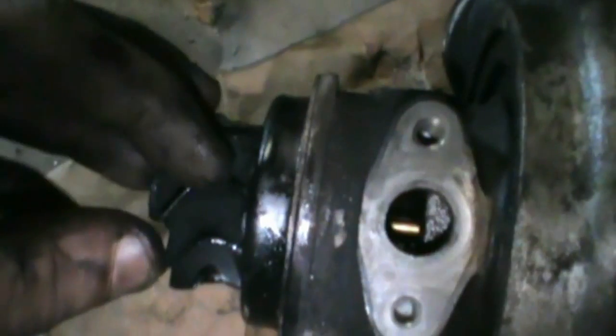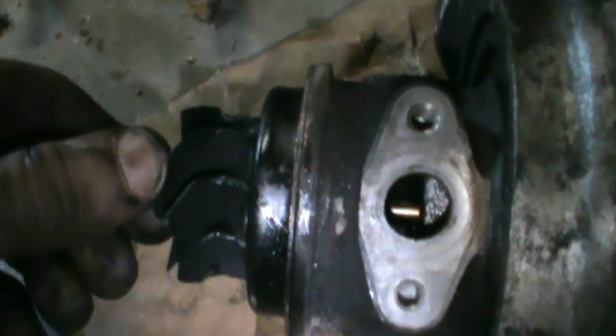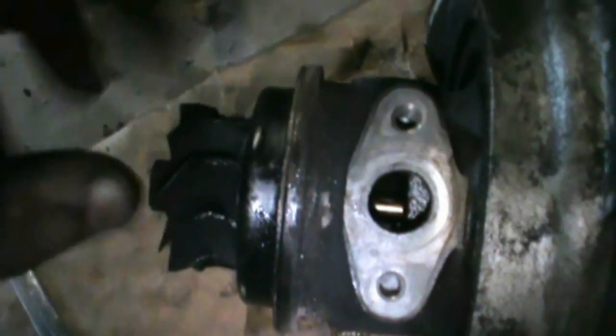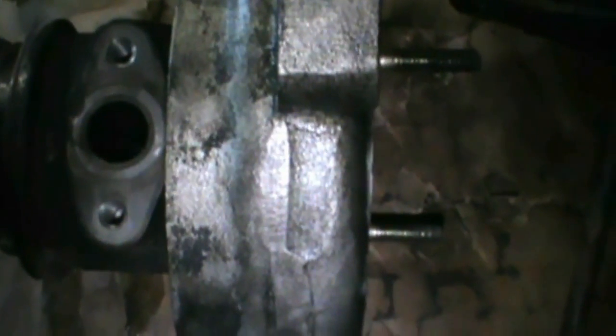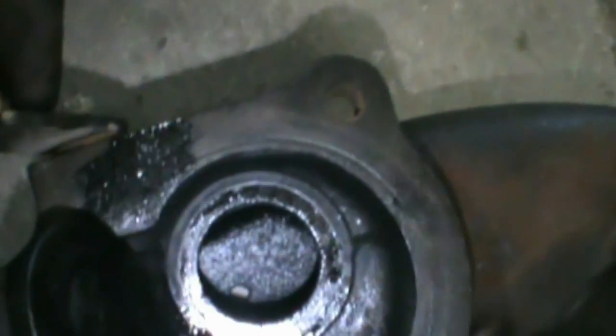Alright, so I got the turbo all broken down now. You can see right here it's pretty screwed. So I'm going to have to go over to Cherry Turbos and see if they'll give me a deal on rebuilding some turbos. I can't really spit chunks of metal through the turbo and expect it to be fine. It kind of sucks because there's like no actual play to this — maybe a little bit of side play. Yeah, I got the exhaust housing right here. You can see this is the wastegate, and you can kind of tell by that ring of oil how much I can actually port it off there.